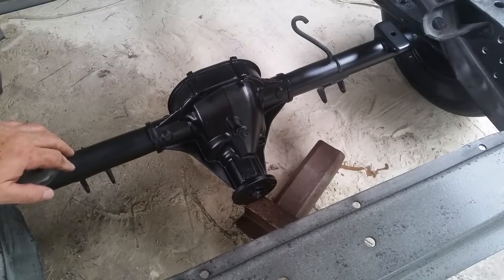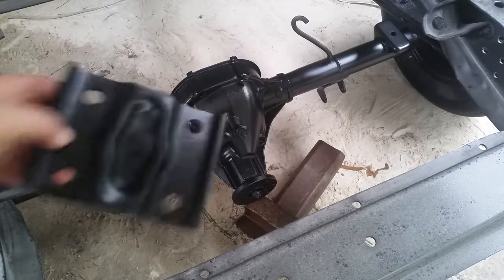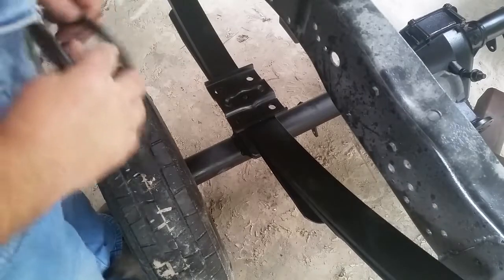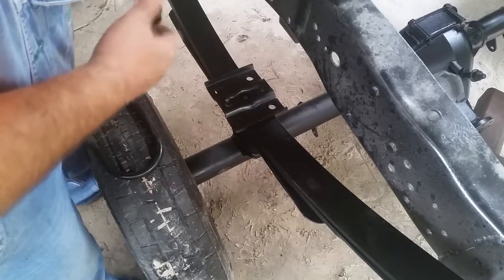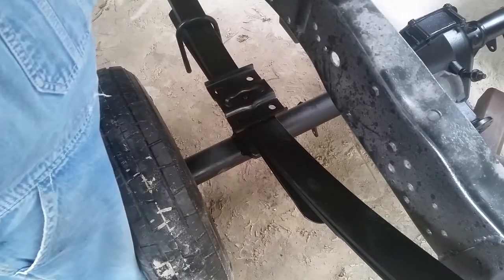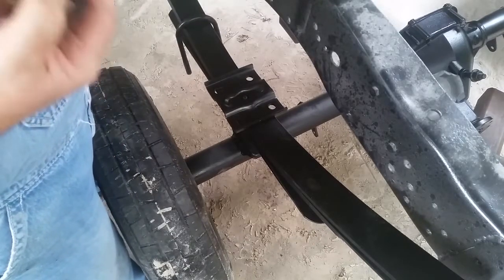Yeah, it's time to get this rear end mounted back up. We got the plate and U-bolts, what have you. Take the nuts all off and just lay your U-bolt back there to get everything on. Alright, taking the nuts off, lay the U-bolts right here. Then we're going to come on down just a wee bit further, down to our dowel pin, and set down inside them all.